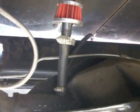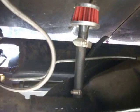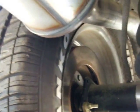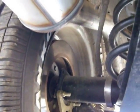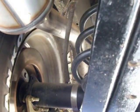Then when we added the True Track, I believe it's from a C10. It's a locker type rear end, and I believe it's 3.73 to 1. So this thing moves out smartly. I had to put those big giant tires, they're 12.5 inches long, side to side, because it would literally fry both tires off the truck, and I had 235/70/15 truck tires. So even with those big monsters on there, it'll do burnouts. Still never let her know.